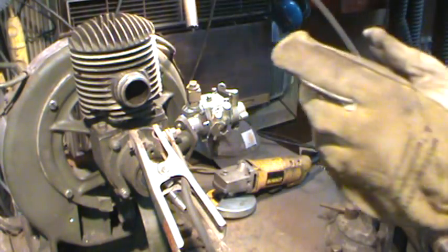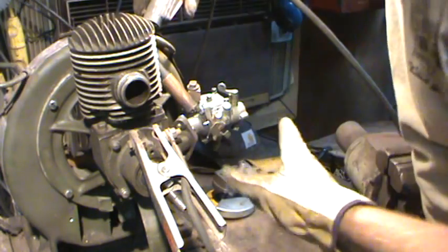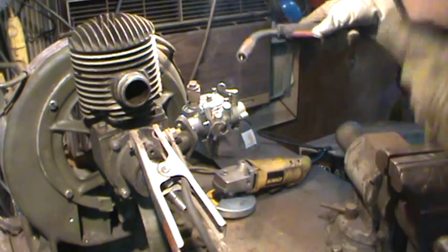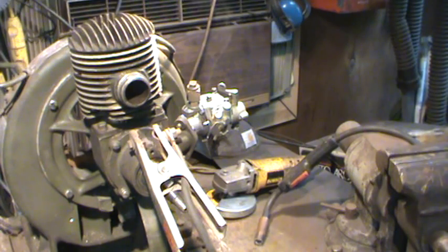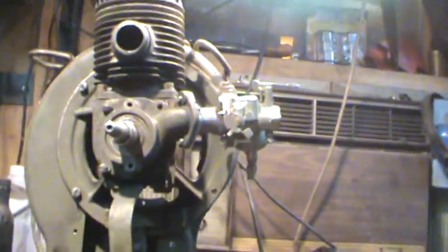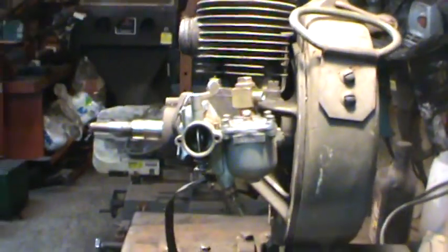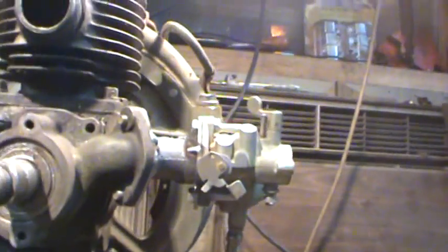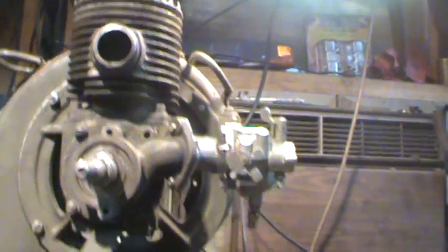Probably, I get in there. Let's say I might have to bolt the carb. Good. So, it's going a little uphill. The motor sitting in that stand is actually kind of sitting on an angle, so I was kind of going for square, which it is. Close enough. We'll stick a piece of wood under the stand to get the motor straight, but you figure something like that. Now the motor's up and down. Anywhere close enough is good enough for it to run anyway, as far as the float's concerned.